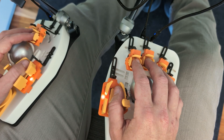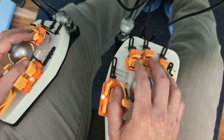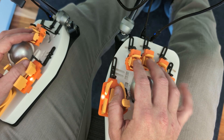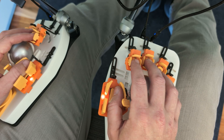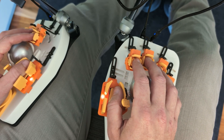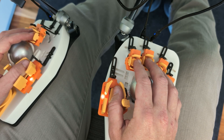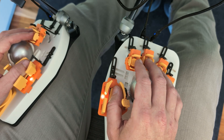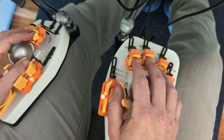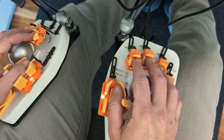Keep in mind, the amount of motion you use to hit an outward key on a small board or on a Data Hand device is so, so small — it's not reaching with your pinky way over here. It's a couple of millimeters, you can barely even see it given where the camera is. And the amount of force is also incredibly small, because it's a 20-gram switch with a magnetic breakaway — only 20 grams at the start, and it falls away super easy. That's what lets these keys work really well.